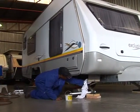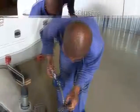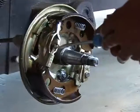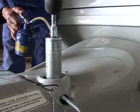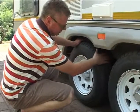This periodic check and miniature service is the minimum requirement for keeping your Caravan in good condition. Whenever necessary, clean, adjust, and lubricate the following items: the brake mechanism, the corner steadies, the towing coupler, the jockey stem and wheel, including cleaning and re-greasing wheel bearings and end play. Check the tires for irregular wear.